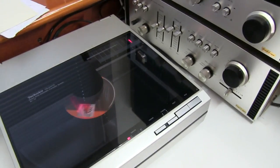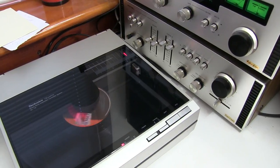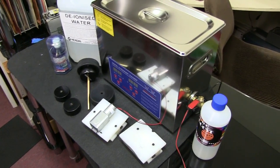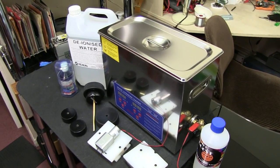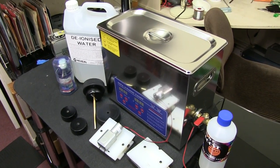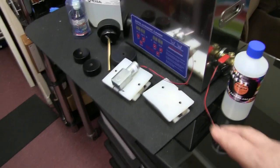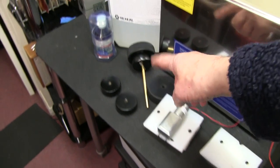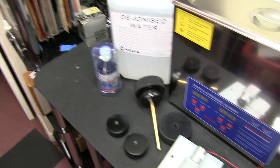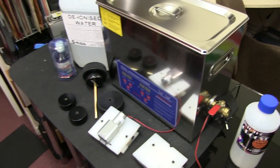Cleaning works very, very well - the best result I've had from all sorts of methods of cleaning. In conclusion, I fully recommend an ultrasonic cleaner for cleaning records, especially if you've got lots of old records from the 60s and 70s, or you've bought a rare record off eBay with a lot of background noise. It really, really gets rid of all the crackles and reduces all the noise down. The cheap ultrasonic cleaning setup - just with a motor, couple of bits of plastic, deionised water, a little additive for vinyl wetting, and optionally a pre-clean brush - it's all very cheap. I've been very pleased with the outcome.